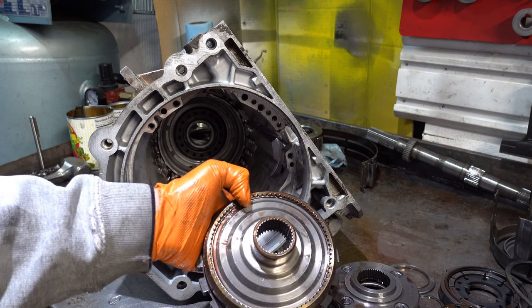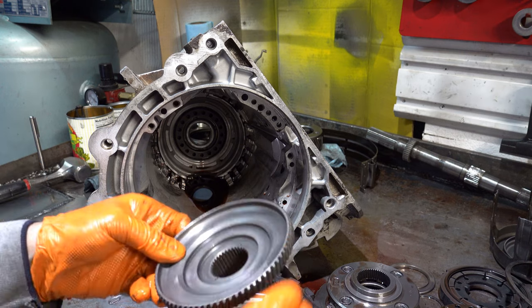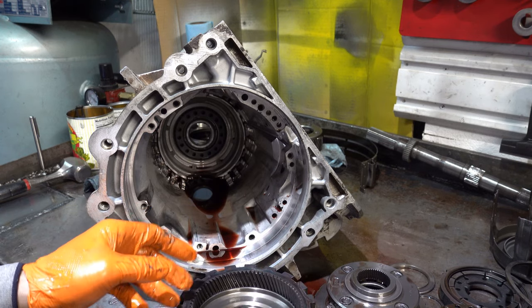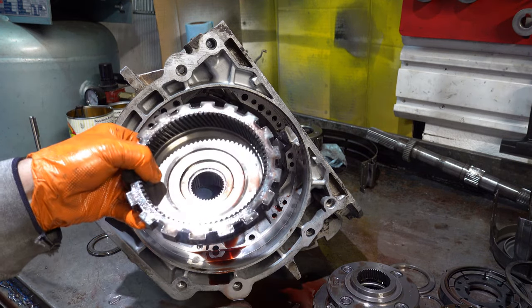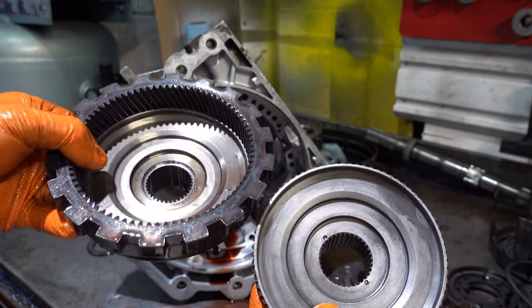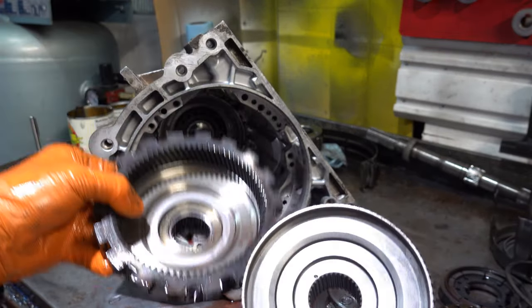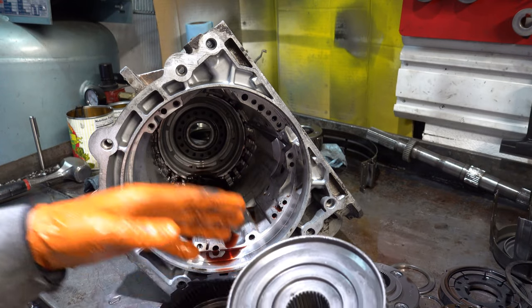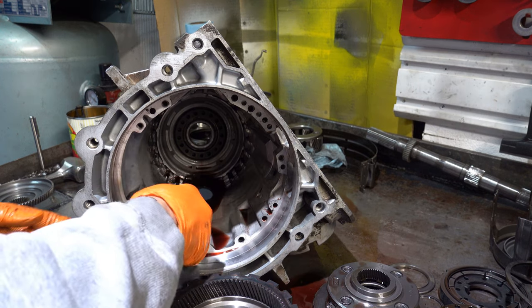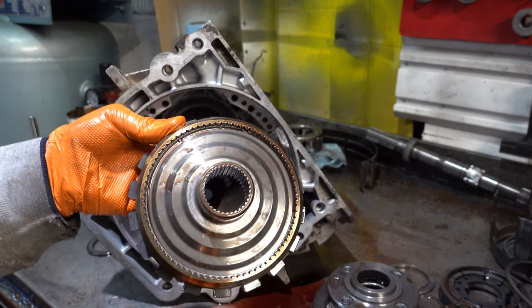All right, so there's a snap ring here, and this half and this half are not joined or anything other than being held together with the snap ring. So the good news is this bottom part can easily be replaced, but yeah, that should not look like that. I mean, that looked like it was machined. It felt like something sharp in here, and I'm like, what in the world? Why is that trying to cut me? That shouldn't be. So this will obviously have to be replaced.